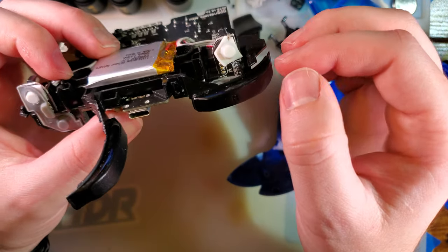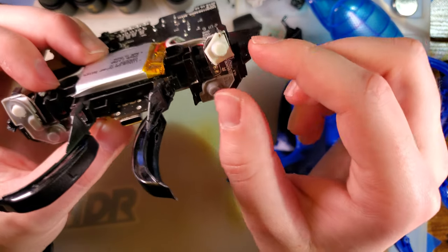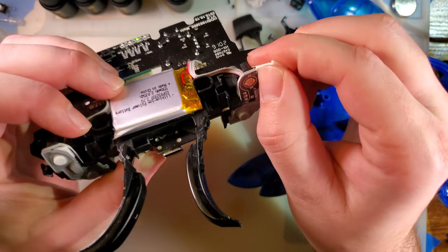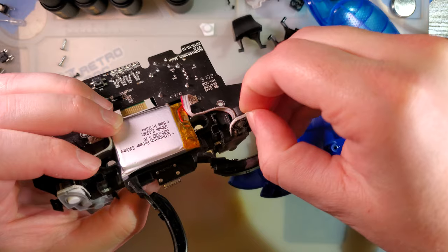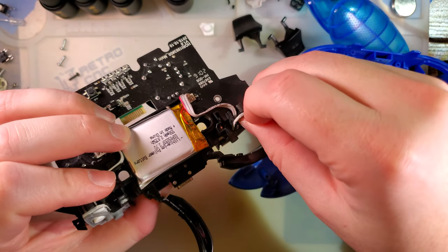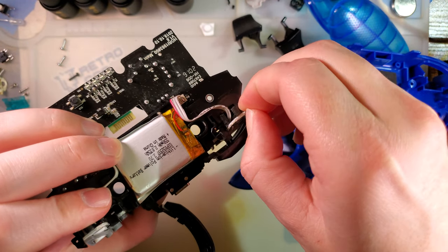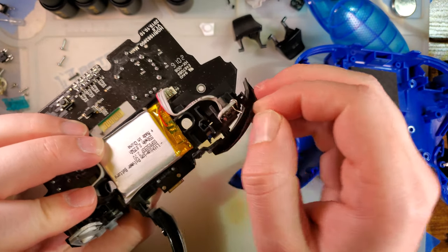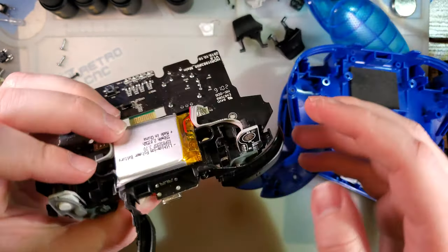The other option was to just cut out the membrane itself and cut the other ribbon in half and just stick the membrane down and hope for the best, and that did seem to work somewhat, but I'm also dissatisfied with that. I've already totally forgotten which side was which, but one side wasn't showing up unless you hit the button a certain way, and the other side was showing up, it just felt like garbage. So I didn't like either option. So let's fix that. I'm gonna pull out that little piece of wire that I was using as a tie down.